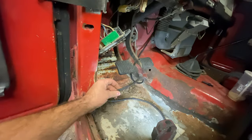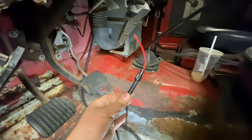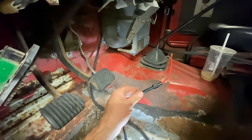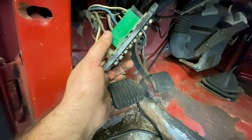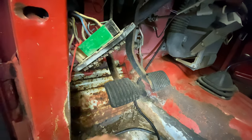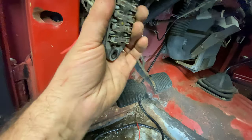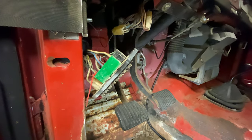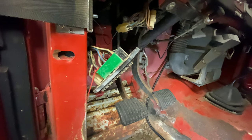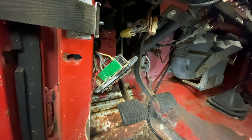Inside this split tube is the wire that runs to the fuel pump and I've got a 10-amp fuse that is required for that pump. We're going to move it right here to the fuse block on the non-controlled side, off this main power wiring, to tap in. We're going to fuse it in there so the fuel pump is on its own fuse - it won't affect any of the other systems or current draw. We're going to cut and splice in here, solder a nice connection.